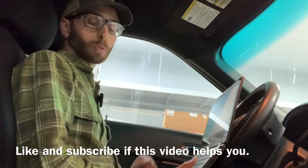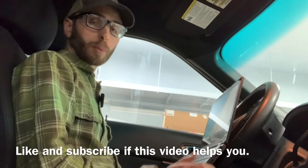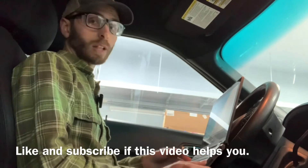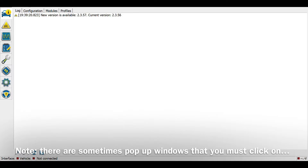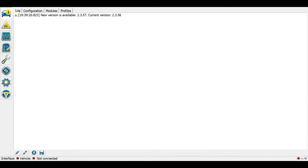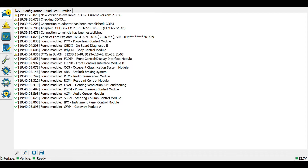Now that we have the sun load sensor and the headlight switch installed, we need to program the vehicle to properly utilize those pieces of hardware. We're going to use ForScan on this laptop. We have our laptop connected to the Explorer via a USB-to-OBD dongle — I'll provide a link in the description. I'm going to roll the key to the on position and click the Connect button in the bottom left. It says 'Ready,' which means we are good to go.